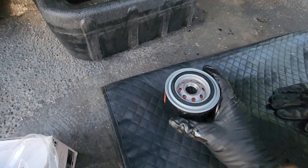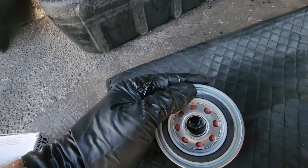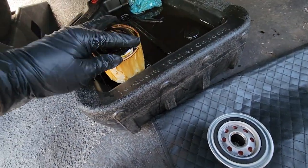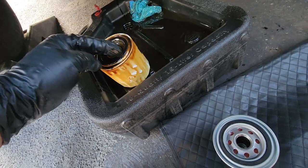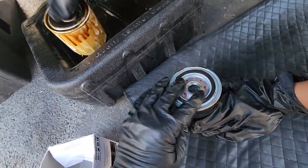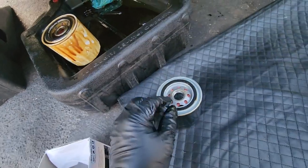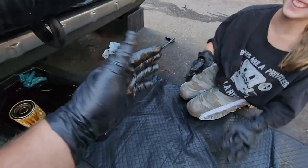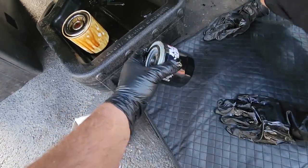The new K&N filter is completely dry but we don't want to install it dry. There's a rubber gasket right here that seals the oil filter onto the engine — we want to make sure the old gasket came off. If we double up the gaskets they'll leak, so that's confirmed: one gasket on there. Now we're going to take some old oil, just a little bit, and rub it right on this gasket to make a nice lube — it'll help the filter go on a little better and give us extra tightening and lubrication.